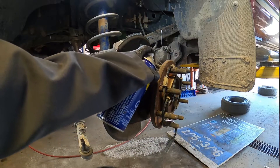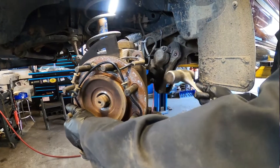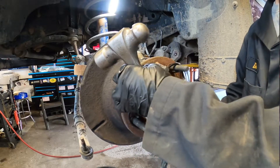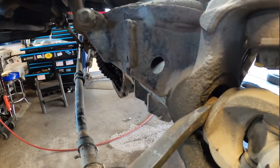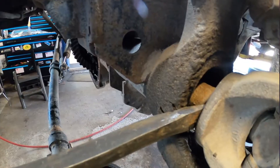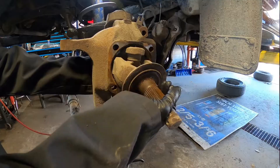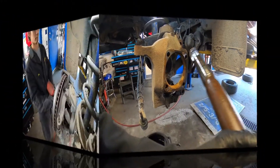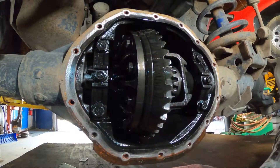Apply a little bit of WD-40 and just very lightly tap on the bearing so it comes out easy, just like that. Now going to remove the axle shaft with the pry bar to the housing - just pry a little bit and it comes out very easy. On the passenger side the process is the same as the driver side.